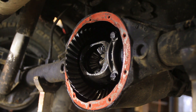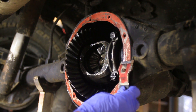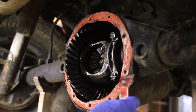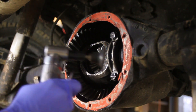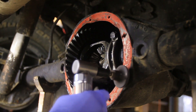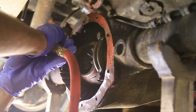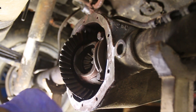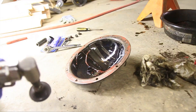If you have a parts cleaner, this would be a good time to use it as well, but I don't have one. Now take a razor blade and scrape the cover surface pretty good with a razor blade and paper towel to get it nice and clean, so that when you put the new seal on it'll be a good seal. If you have a die grinder or an air grinder with a little abrasive pad on the end, it'll make a lot faster job of it. That's nice and clean, but since I got dust all in there, I need to clean out the inside once again — and the same with the cover.